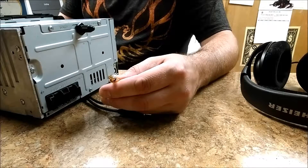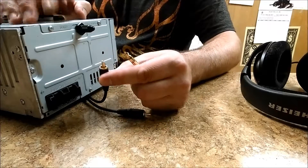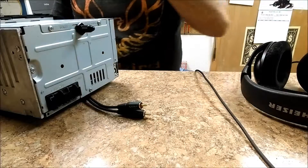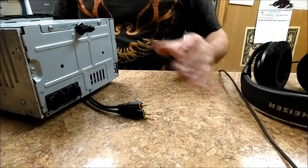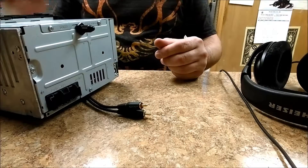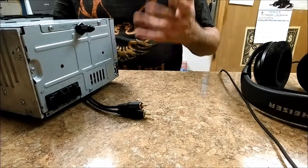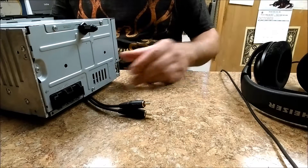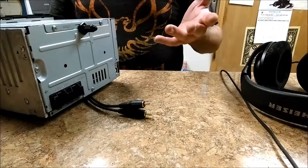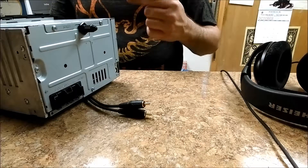You've now found where the distortion point is coming off the preamp feeding your RCAs, which would be feeding your amplifiers. Pretty simple and self explanatory. Go ahead and write that number down — 45 is basically the highest point you want to stay at with your volume. Now it's time to run your amplifiers, which will be covered in the next video. Take care guys.